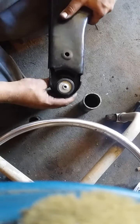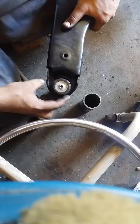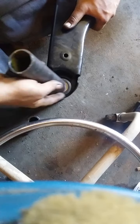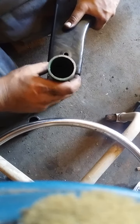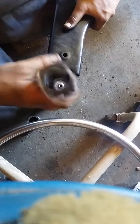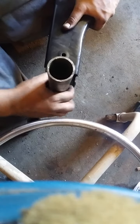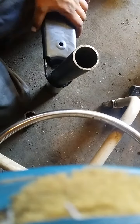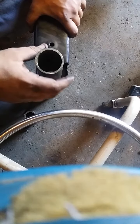When you go to install it, use the same large piece of tubing on the bottom side, centered on the arm. Then there's another piece of tubing from Industrial Metal Supply, Patton's, or wherever you want to go, that fits the outer ring on the ball joint. See how it's straight — there's no gaps. That way it goes on nice and tight. Put it in the press, press it on, no problem.